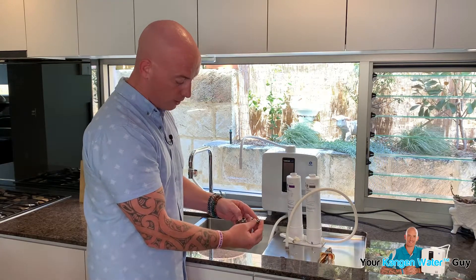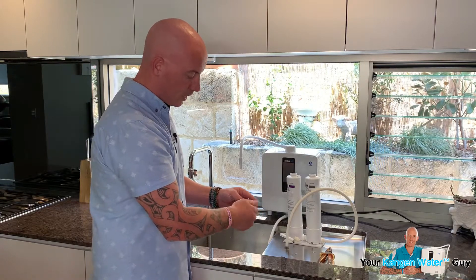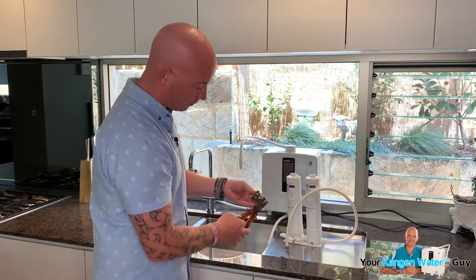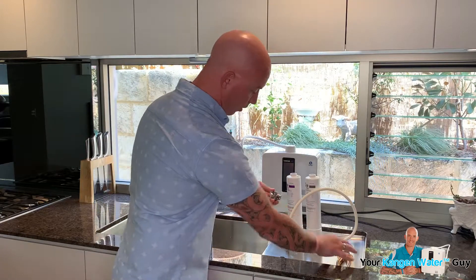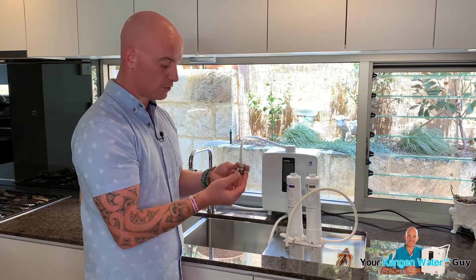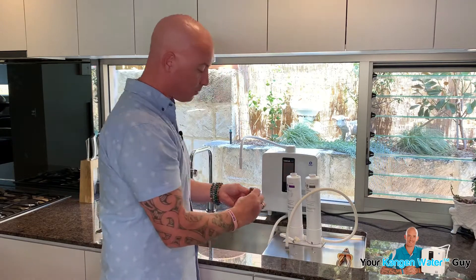You can't get this the wrong way around. This one's got a rubber washer, so you're going to screw that in place and then tighten it up. Just using the round part of the pliers, just nip it — there's no need to go any tighter than that. It's got a rubber washer, it's going to be fine. So we now know that this is clear. You can do some blowing through it to check. Everything's good. I'm going to put that all back together.